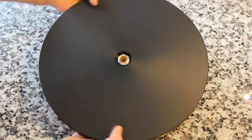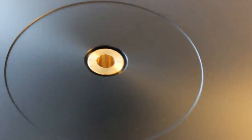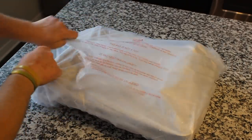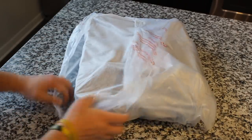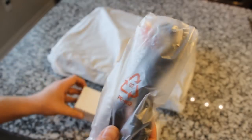That is a 20-millimeter thick anti-resonance polyoxymethylene platter, and it is heavy and solid. Why do you need such a hefty platter? It's all about inertia — things in motion tend to stay in motion, kind of like a train. Any electric motor, such as the one on any turntable, is going to have speed fluctuations. You want your platter to be hefty so that it doesn't respond to every one of those variations, therefore giving you a more even speed and very even tone and quality sound reproduction versus one that's warbly. That really helps to eliminate wow and flutter.